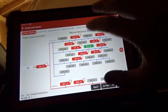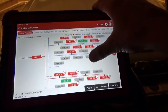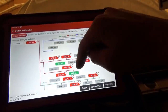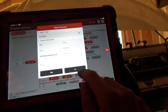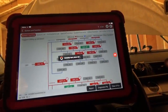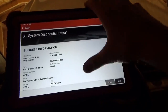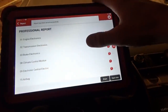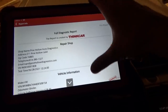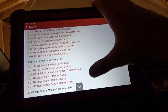Code scan complete - it took a few minutes. This thing has 23 modules. A lot of codes stored. Let's generate a full report. Opening the report: lost communication codes - obviously with that diagnostic bus offline we're going to set all kinds of codes. So we want to clear all this junk out. Clear DTCs. The Think Tool Pros takes care of it pretty quickly. Then we'll do a key-off, let it go to sleep, and try to start it.